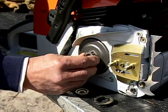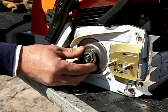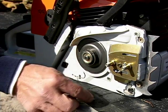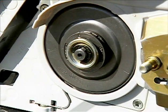When reinstalling the drum on your Stihl saw, rotate it about 1 turn to make sure that you've engaged the oil pump drive. Slip on the rim and reinstall the washer and E-clip. Other styles may require the removal of the clutch first with special tools to access the sprocket for maintenance. Check your owner's manual for the procedure to properly replace your sprocket.